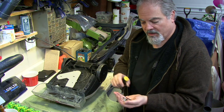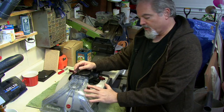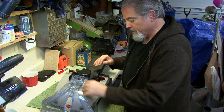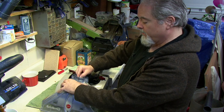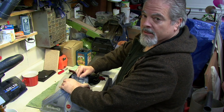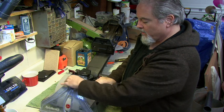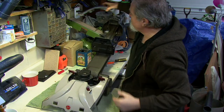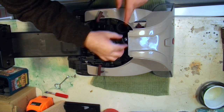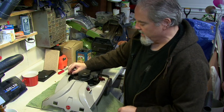Make sure you keep an eye on which screws are which. After removing the screws from the bottom, flip the unit over and remove the extractor — just lift up, there are no screws, then pivot it forward and take the extractor off. There's one screw that was behind the extractor; take that out.